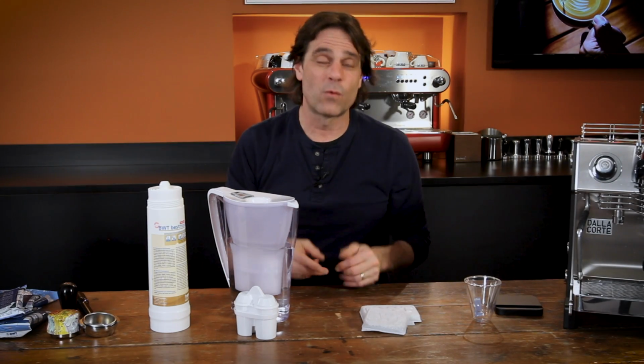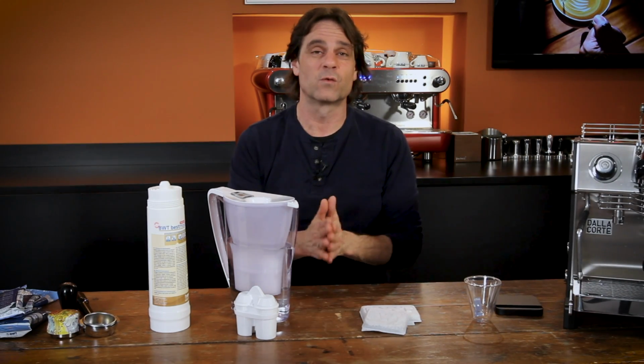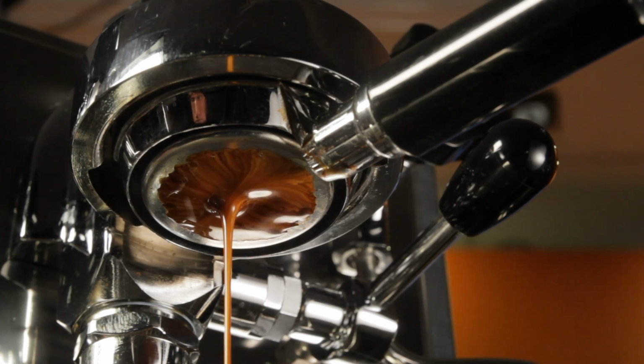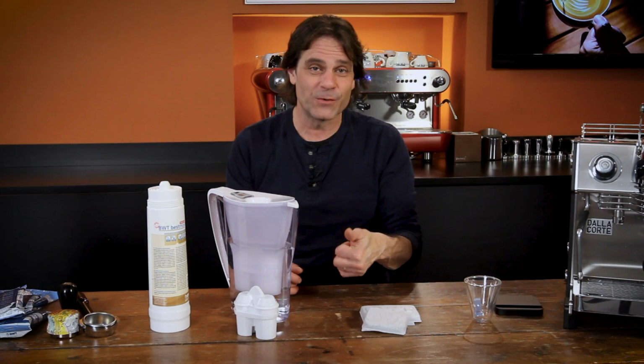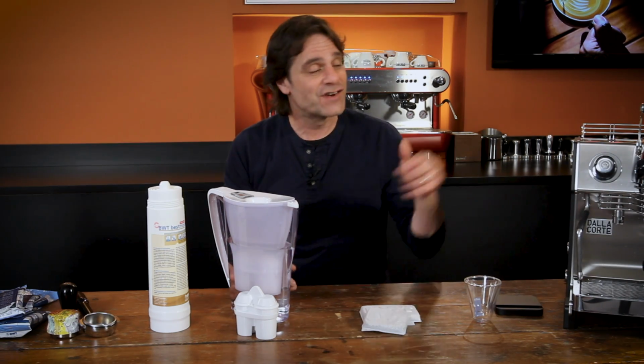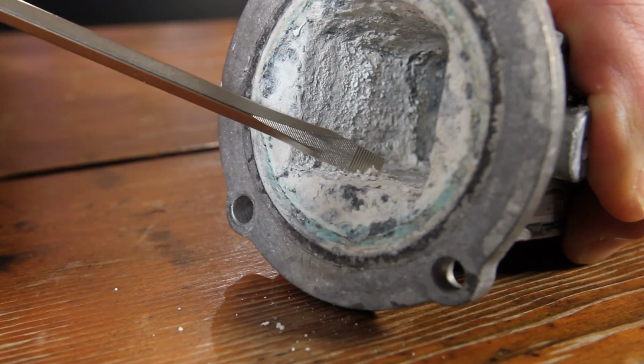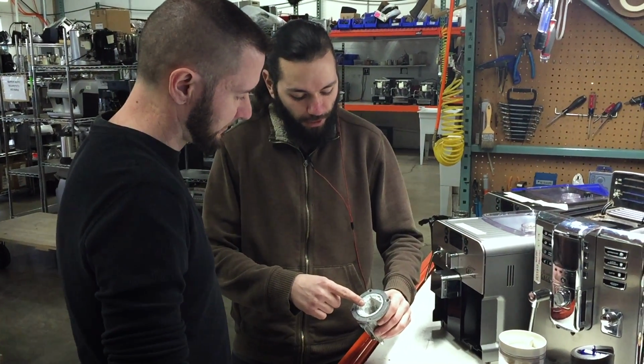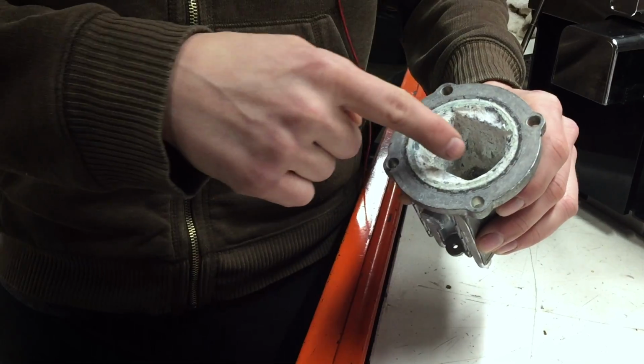Next up, let's talk water, and two reasons we're concerned with water. Number 1, you want a water that's going to give you a nice tasting espresso. That means getting rid of chlorine and having the proper mineral level. Number 2, you want a water quality that is not going to cause scale to build up in your espresso machine, because scale buildup in machines is the number 1 reason for machine problems and failures.